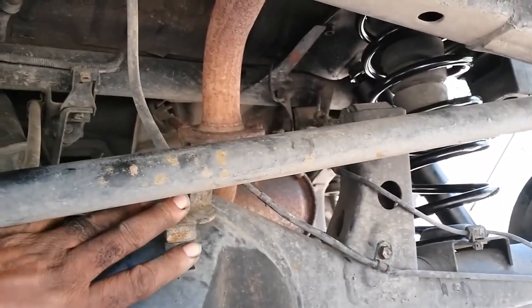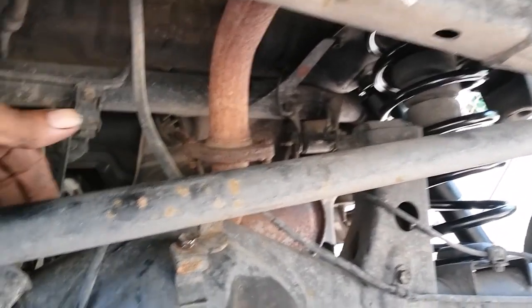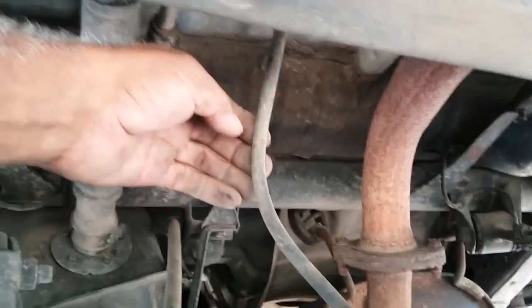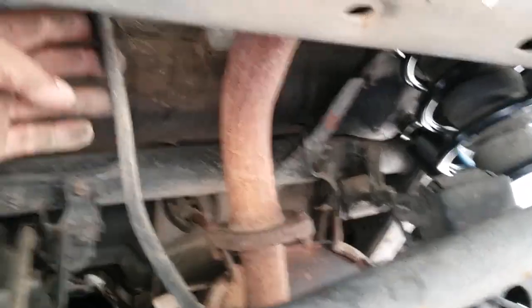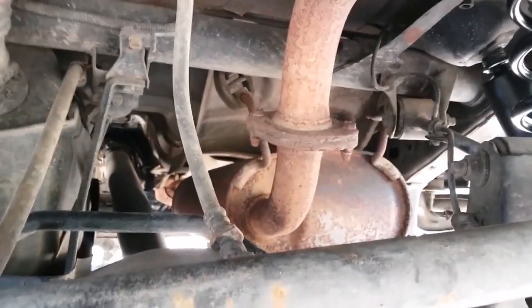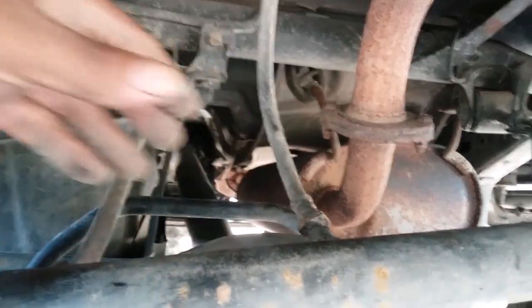The reason why you're taking out these bolts is to give you better leverage when dropping the differential. You don't want to stretch your brake line — you don't want to stretch it to cause it to kink or burst, because your life is at stake here.